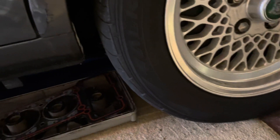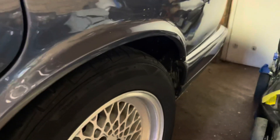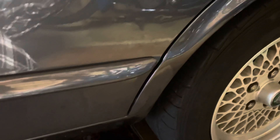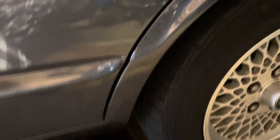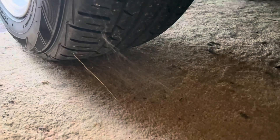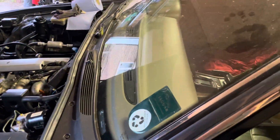I'm also going to be asking your advice about doing a bit of bodywork on this. Somebody ran into me in a pub car park and drove away. There are a couple of marks from that which need to be addressed. I'm not going to make it perfect, but there's filler to deal with here — this was actually a new wing, a new arch that's been welded in, and they did it on the side that was actually in better condition. There are also some other little bits down below here and there. There's a bit around the front of the wheel arches — same the other side really. It's not horrid, just a few bits that might need a touch up to slow down the corrosion a bit.